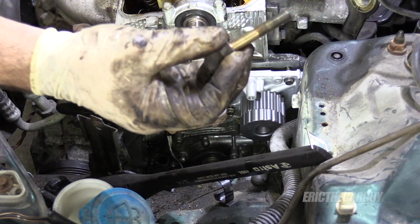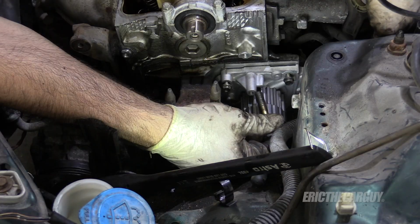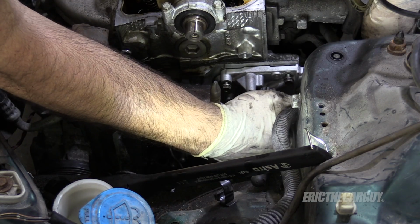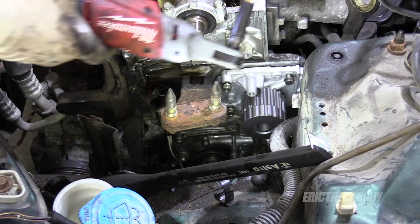I'm going to take that 14mm that I took out earlier with this bracket. I'll pull that back, that upper alternator bracket, and insert that 14 in there now. And we'll tighten the fasteners. As far as torque, couldn't tell you. Never torqued them. But it's not much, so you don't want to break them off in the block. You just want them to be snugged up and seal.